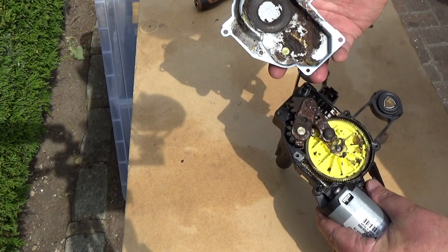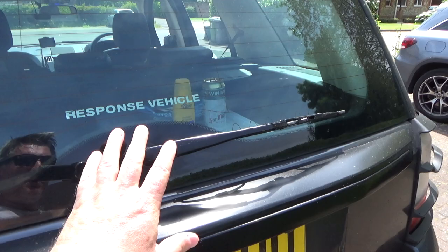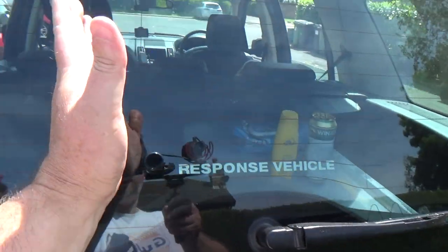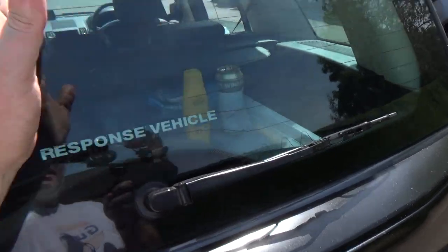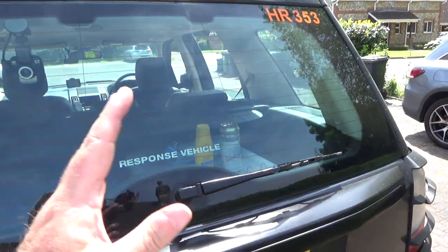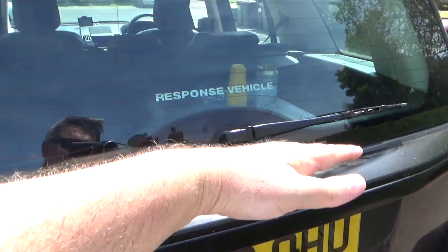Oh my God. Hi, welcome to my latest video. Today I'm going to be looking at the rear wiper motor. A few times recently my wipers have wiped, got to about there and stopped and not parked back. And no amount of waggling the stalk on the steering column has allowed them to sort of get moving again. I've had to actually get out of the car, push the wiper arm to get it to park.